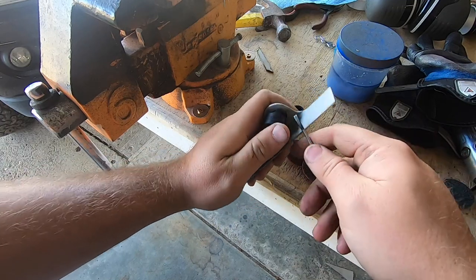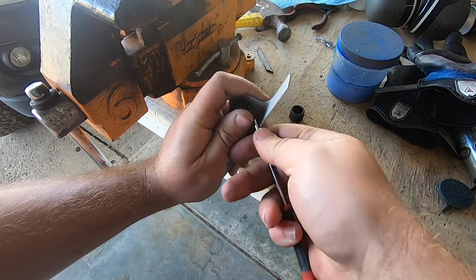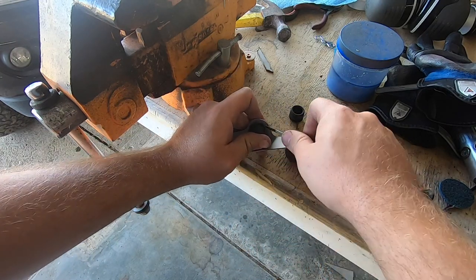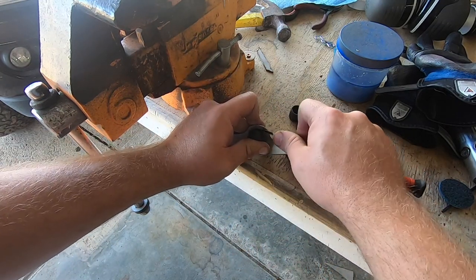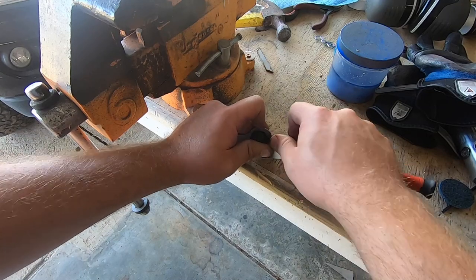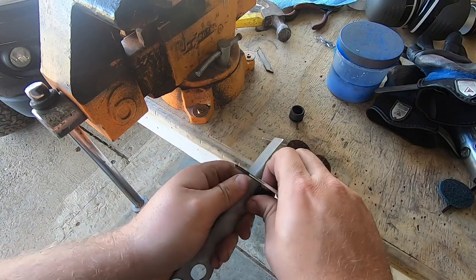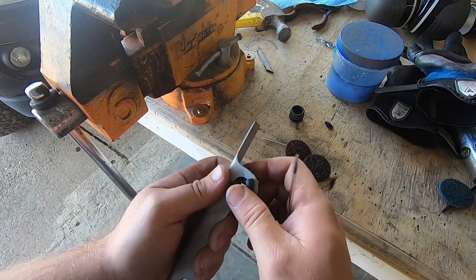After tack welding those pins on, I moved on to fabbing up the bracket out of some stainless scrap offcuts from another project. This will bridge the engine mount tubes and hold the rubber isolator bushings. I managed to get a bit aggressive with one of them, so I'll have to order another for final assembly when that time comes. Now to trim up the ends and locate the P-clamp holes for hardware.